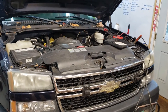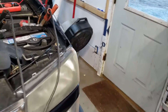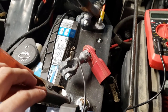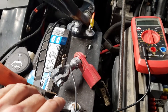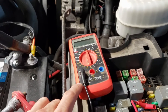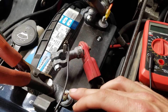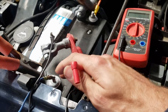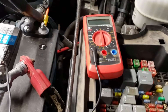Right now I have no lights, nothing on, and I'm going to show you what happens. The battery is disconnected, and the important thing to remember about measuring amps is the only way to measure current is to go through the ammeter — we have to do this in series. The battery post is disconnected and I have jumper leads, one on the post and one on the main going to the truck.